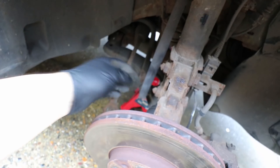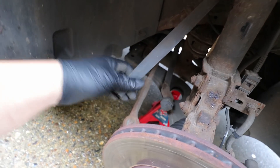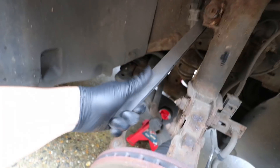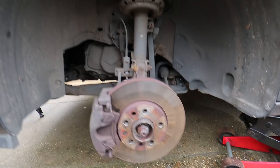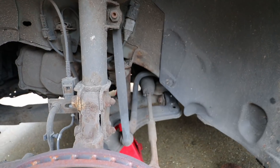I've gone ahead and checked everything else and everything else looks okay. Chances are that this car probably hit a pothole or something — this was already weak and that just sheared it off. The brakes look good, tie rod ends look good, CV boots look good, spring and strut looks good. So anything we've got to worry about is just this drop link on this side. And if we come over to the passenger side, it all looks okay over there.